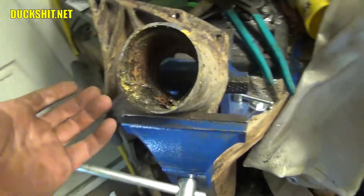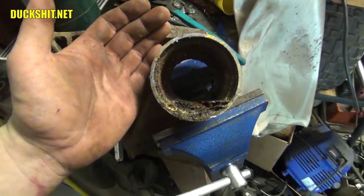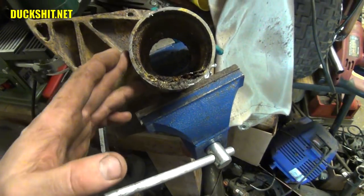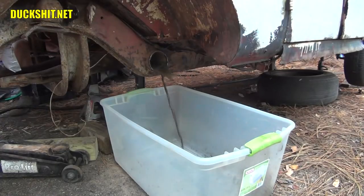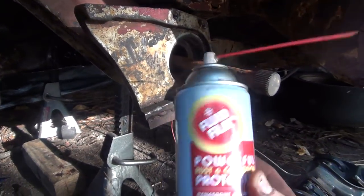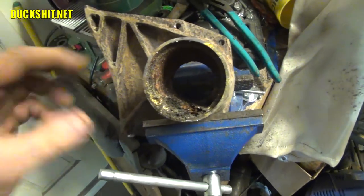The bottom of the tube seems to be fine. There's no holes along the bottom of it, so if any moisture does get in there, there is no way for it to get out other than through points higher than the bottom of the tube. I tried shining a light through and looking around on the outside of the tube underneath the bus to see if there were any holes anywhere, and I just can't find anything. Apparently no holes, so all the water must have come through on the outside. I'm probably going to rinse this through, get all this crud out of here before I weld everything back together, and chase the entire thing out with some oil — even some old used motor oil. Just coat the inside of it, make it all nice and sticky in there, and slap it all back together. That will help prevent it from rusting in the future.